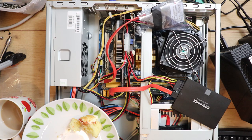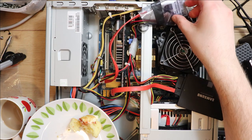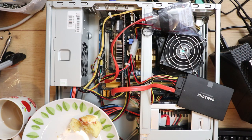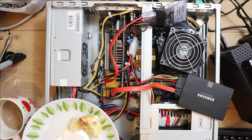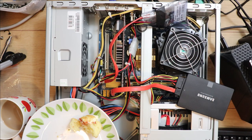Even though modern mechanical drives can now hit 180 MB/s, using them through one of these adapters will cause serious bottlenecks. For booting an OS though, you don't necessarily need raw transfer rate — Windows isn't loading hundreds of megabytes into RAM. The main advantage of an SSD over a mechanical drive is access time: SSDs can access various points significantly faster, and that's what makes all the difference in responsiveness.